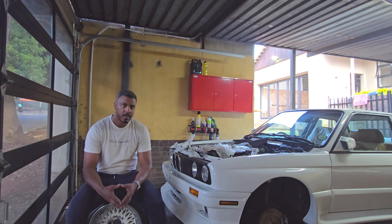The most popular engine swap on a BMW E30 is a multivalve motor. These motors came in a variety of flavors: the M50 B25, the M52 B28, then the S50 which came from the E36 M3, and we can also use the S54 — the 3.2 litre version. What makes this motor such a desirable swap is that it has 24 valves, dual overhead cams, newer technology, and it's so much easier to turbocharge. In stock format it makes 189 horsepower, as opposed to 169 on the M20. And they're readily available — many people are scrapping these motors, so they're easy to find.